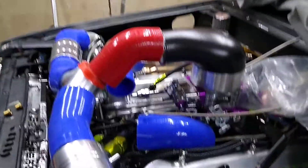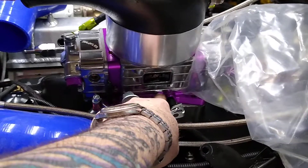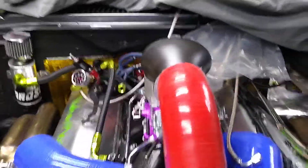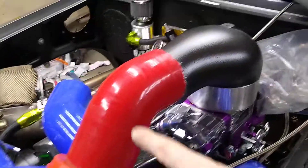Got rid of the one-inch spacer. All that's going to be underneath here is the nitrous plate and the solenoid bracket. Got rid of the plate, drilled and tapped, put a fitting right there for the blow-off valves. Then I've got a manifold that'll feed off the back of this hat right here — back here to feed everything: boost gauge, fuel pressure regulator, and all that. Got this fitting all done, it's welded up.